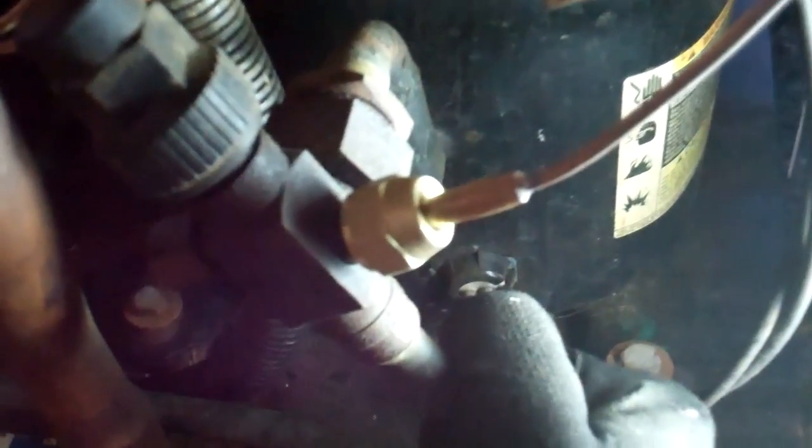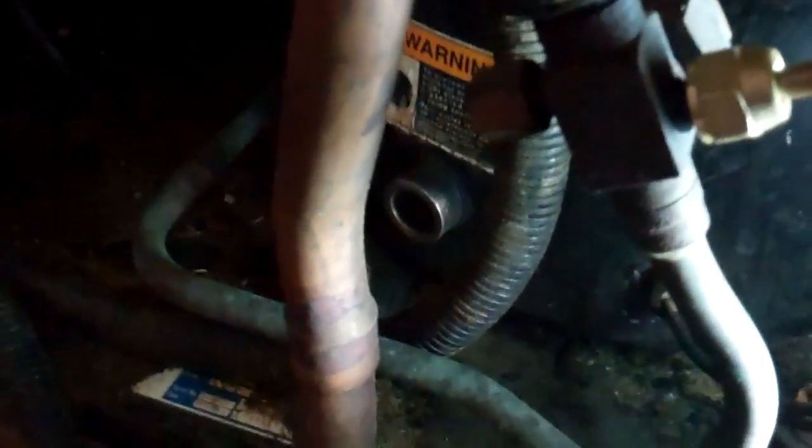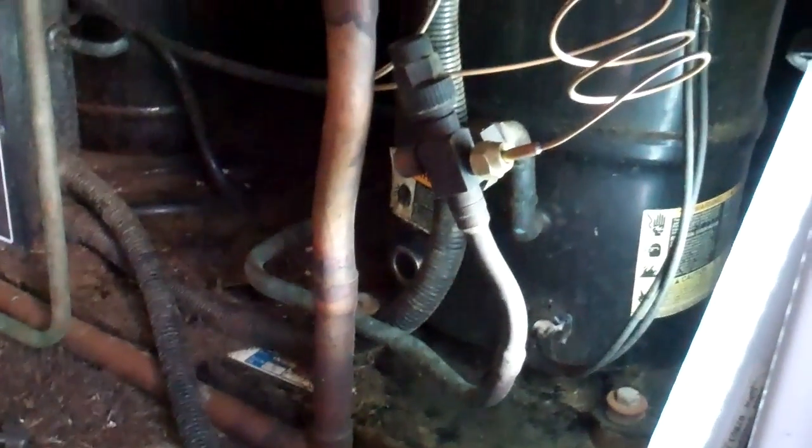I couldn't find anything to start with, then I gave the compressor a shake. That valve is really loose. It looks like the gasket's failed in there. So our gasket's stuck in the valve — it should be in that little groove. It's quite loose.